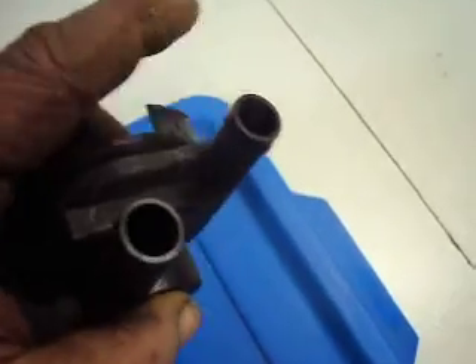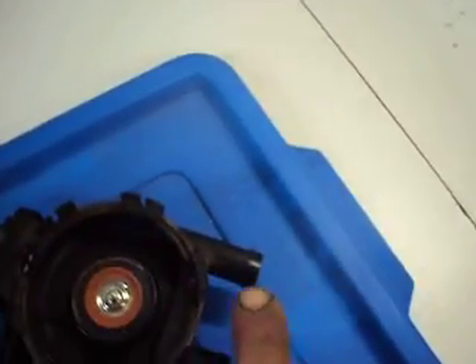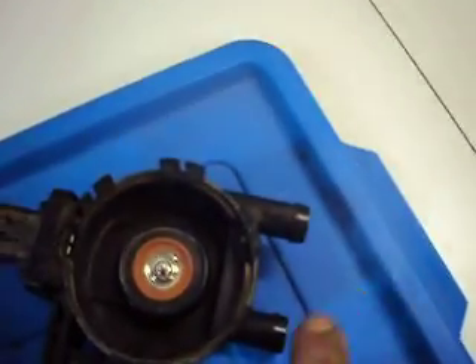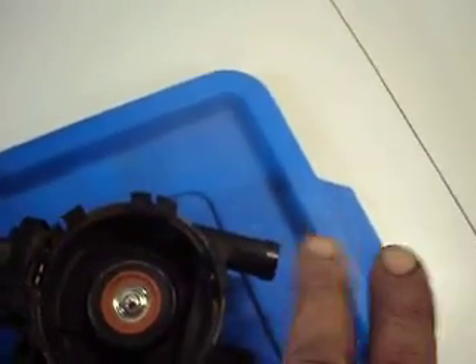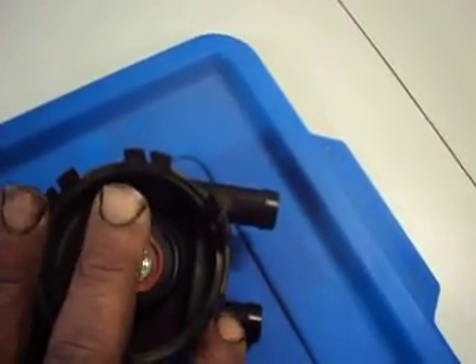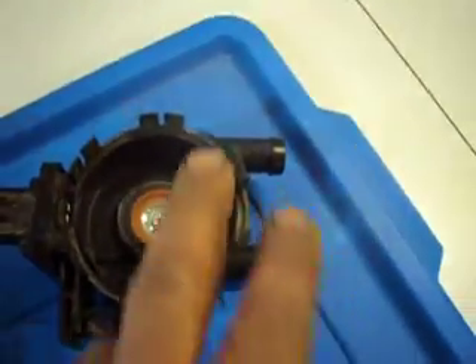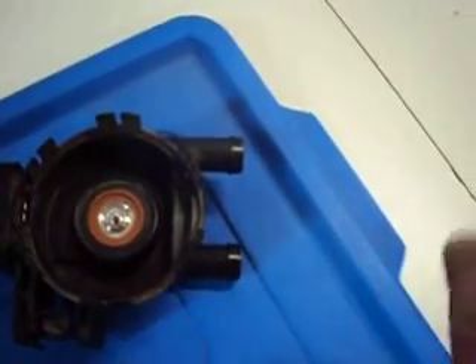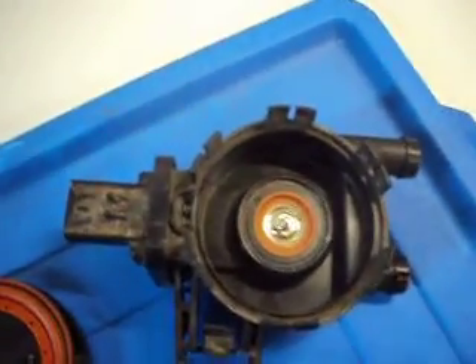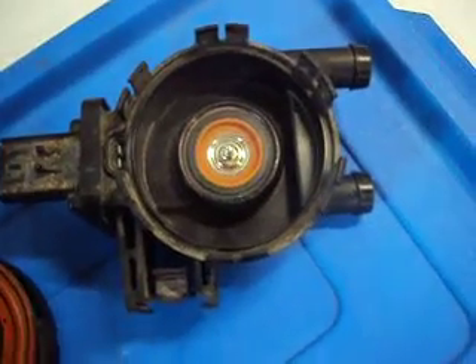We have two ports on here. This port here goes to the vent — it's the vent port — and goes up to the filter to keep dirt out. So the air would normally during a purge cycle enter through there. And then our other port here goes to the canister, which the air flows through into the canister. So during purge, fresh air can enter the canister as the air in the canister gets purged into the engine.